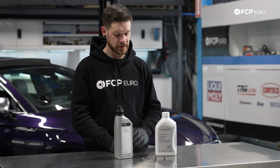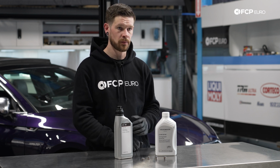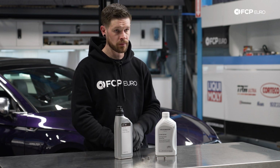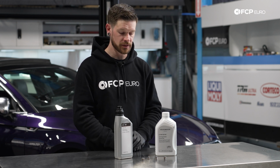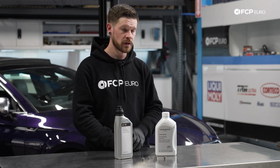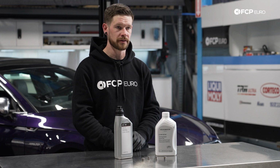In order to identify the differentials, you will need access to the PR codes, which come in the vehicle's identifier, commonly found at a dealership. Some aftermarket shops may have access to this, but in order to correctly identify it, there is a chassis number on the differential, and that will get you some information in order to identify your differential correctly.